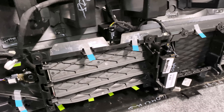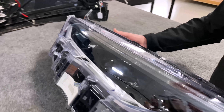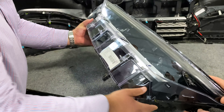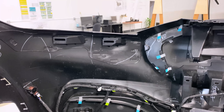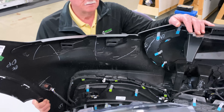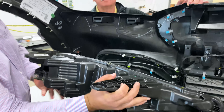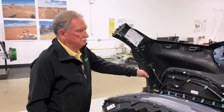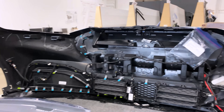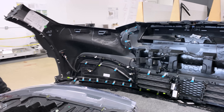But the one I like the best was this one here — the headlamp. Ben, why don't you show them where all this stuff goes. There are a few snap fits on the front. You can see these clips here that will locate to the fascia, and there are some receptors here for those snap fits. When the headlamps mount to the body-in-white first and the fascia is brought in, those clips will line up and snap the fascia to the headlamp. This is a really good idea. Anytime you can get rid of threaded fasteners, it's a good day. We really want to commend Ford on what they've done here — a really good example of how you can get the look without a lot of cost and making it easier for the operators to put together.